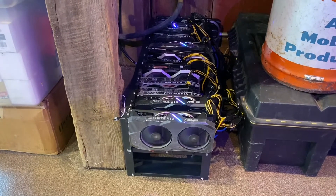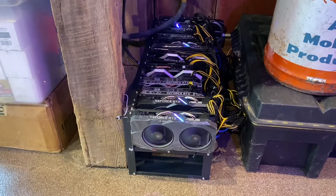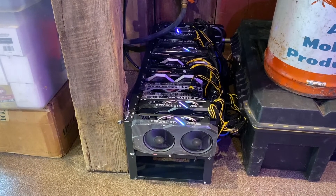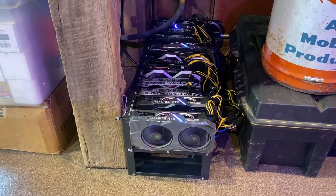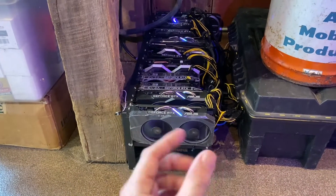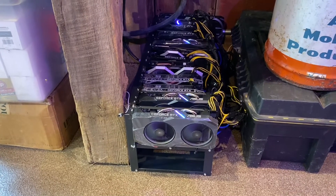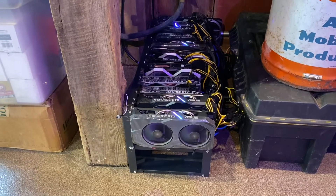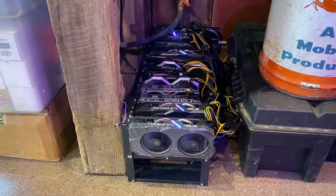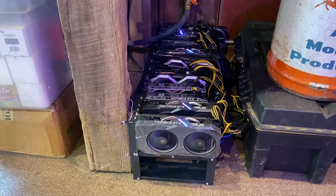This board is really stable — much more stable than the version that has full PCI Express ports, which I covered on my AMD rig. This thing is solid. It's running 12 cards right now and hasn't had any downtime for quite a while, even on a single 1200 watt PSU. The form factor of the board is very small — it's actually micro ATX, very narrow, very short. It only has four standoff holes that match up with a typical mining frame or case, so be a little bit careful when plugging stuff into it. The overhead is about 35 or 40 watts even with an i3, so this thing is definitely designed to be in a rig with efficiency in mind. Let's get over to the Hive OS interface.